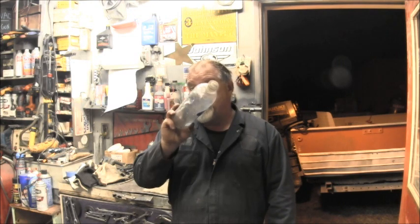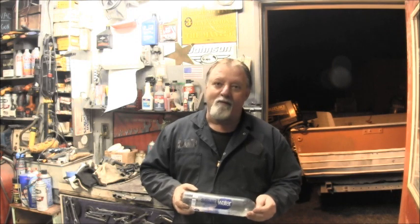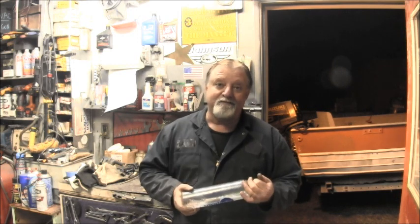And if you think back to it, when we dropped that lower the first time, the original lower, the oil in there looked great. So, drop the lower unit, problem went away. Oh, it's got to be the lower unit. I don't think so. I think it's the power head. Give me your thoughts, because I think something's going on with that power head. Sure, without the lower unit, it sounds great and it'll run good. But you put it all back together, and this is in its second lower unit and leg and all, and the problem's back.